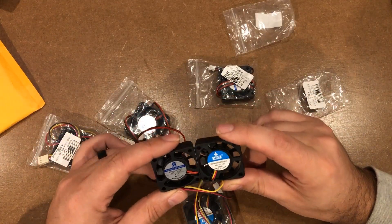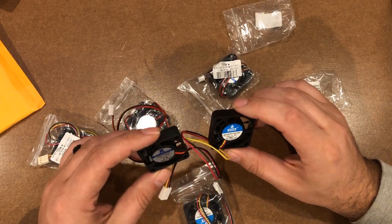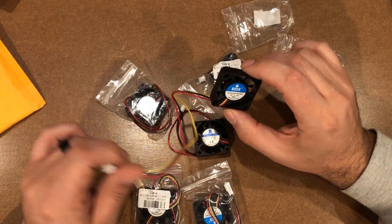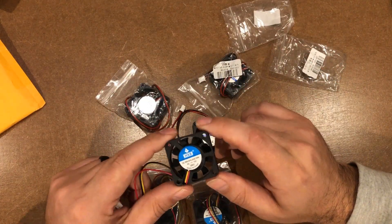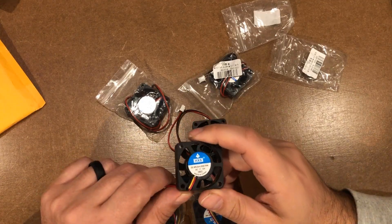I've got them in the PWM three-wire style and two-wire style. A lot of the old 486s and stuff that I have — these little fans die relatively easily. I got these things cheap. To go out there and find a 486 heatsink and fan can be fairly expensive, but to replace one, this is probably like a buck or two.